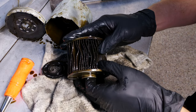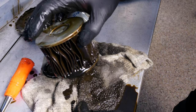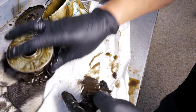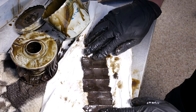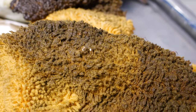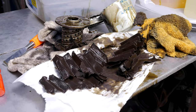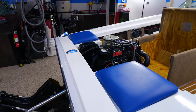Now what we're looking for is metal. Oil looks horrible, absolutely horrible. Pull some of the filter element out and stretch her out. All I can find so far for metal shavings is just a couple little pieces of shiny copper, which usually indicates a bearing. We've got to keep going further, which means, unfortunately, the engine's got to come out.